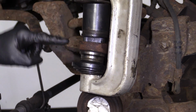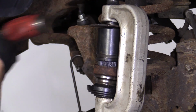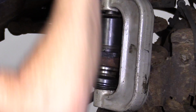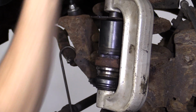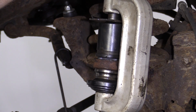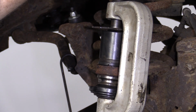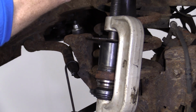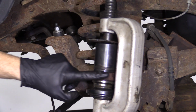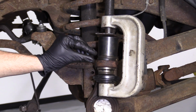Just like we were doing the lower, you want to make sure that this is getting driven in straight up and down. If it's not, just resituate it. This looks like it's working great, so let's continue. We're going to bring this lip all the way down to the ear. That looks wonderful. Okay, I'm going to use my hammer. I'm going to give the ear a couple bonks, and that's only for vibration. And that'll help it just in case it's kind of sitting just a teeny bit off.